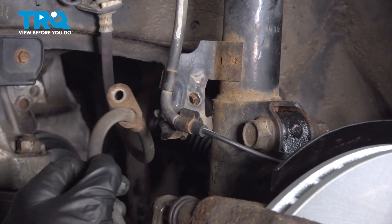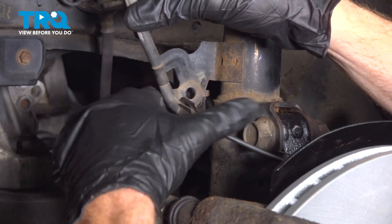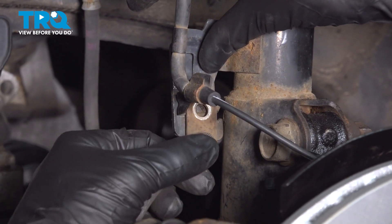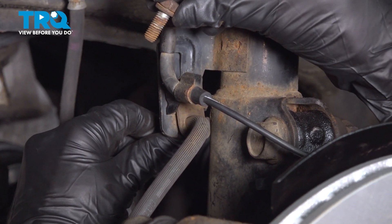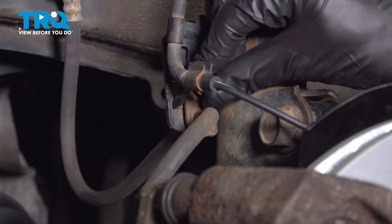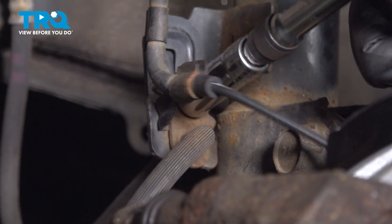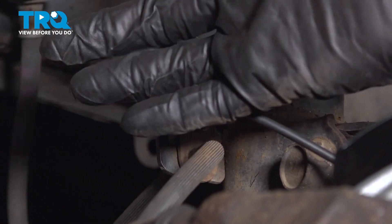We'll make our way back to the ABS wire, the flex hose, and our front strut — we're going to re-secure everything here. Take the ABS wire and put it in position, aligning the mounting bolt hole. Then continue with the flex hose, which slides right underneath this area, holding the ABS wire in place as well. Continue on with our 12-millimeter headed bolt — start it in and snug it up. Make sure it's completely secured; you don't want it coming loose and hitting something, potentially causing damage.